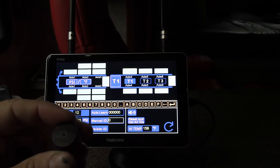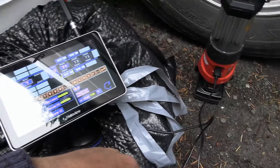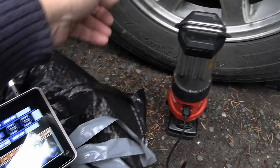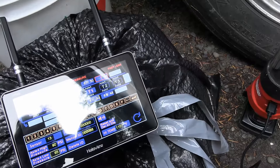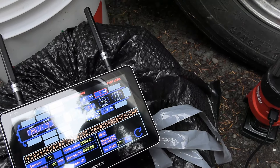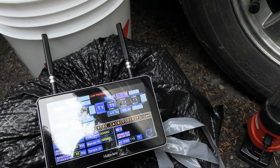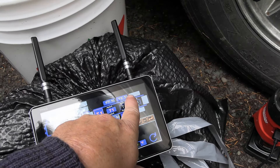Ann's got the truck right now so I'm just going to put the four trailer tires on and do a quick test. You can see you can plug the USB-C into a portable pack — I'm using a Milwaukee light here — which makes it easier when doing the learn function. Let's try taking one off like we're losing air. There we go — fast leak! It's showing a low pressure fast leak warning. You can see it's showing 66 PSI and 50 degrees, pretty close on all the tires.